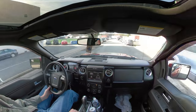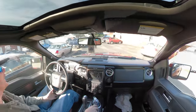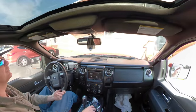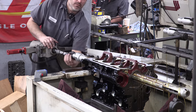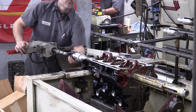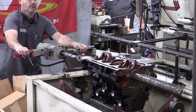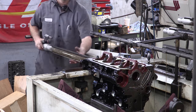It's been more than a month before our schedules could realign and grant us another opportunity to work together on finishing it up. Better luck on day 2, maybe. I guess we're gonna find out. Previously, we had 4 out of 5 correct. It didn't help that the number 5 crankshaft journal is a half thousandth smaller than the rest of the journals, and it ended up going way oversized despite our efforts to prevent it.